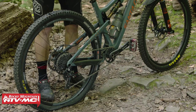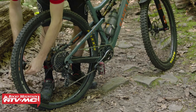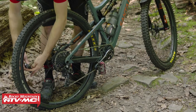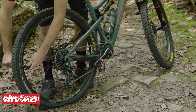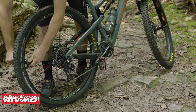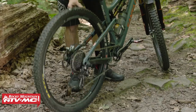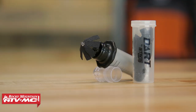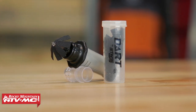What's unique about this setup is that once you've done that, you rotate your tire to get the sealant to the barb you just put inside. This material has a chemical reaction with Stan's tire sealant that creates a permanent bond, plugging your tire. Once it creates that bond and plugs the hole, you don't have to worry about it falling out or letting any more air leak. They say it's a permanent fix — so rather than using a standard plug kit and then having to patch inside or replace the whole tire, with this you have a permanent solution and can continue riding.